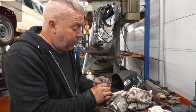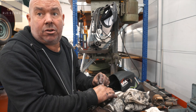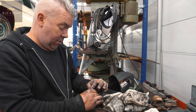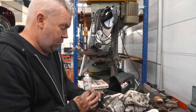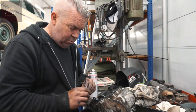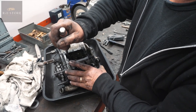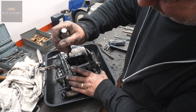It's all good and well if it's welded and it holds oil, but that side piece there is never going to seal. I can build it up with weld, I can faff about on the milling machine, but by the time you've done all that and done a load of hours labour — if they're 300 euros just get a case in. Everything on the inside is replaceable. None of this feels done up tight. That'll be why the kickstart was slipping.